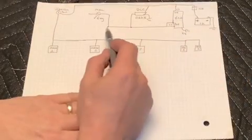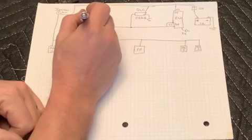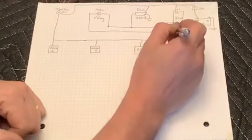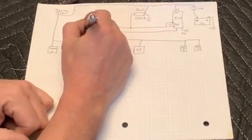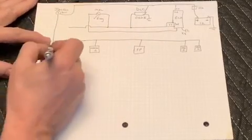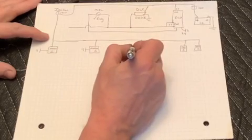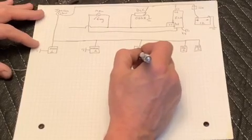So the ECU has 2 pink wires that come off of it that are for keyed or switched power, and you'll see I've run that line over, and the OBD2 pin DLC connector next to it, as well as the positive side of the MIL light also is connected, and the MIL runs back to the ECU for the ground side, which is what the ECU controls for that check engine light MIL.